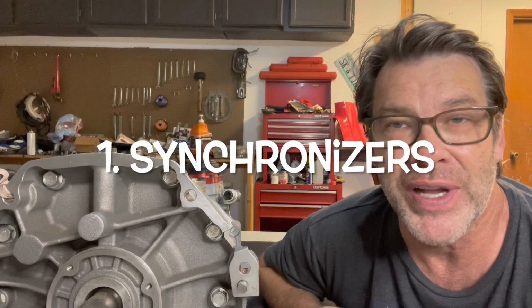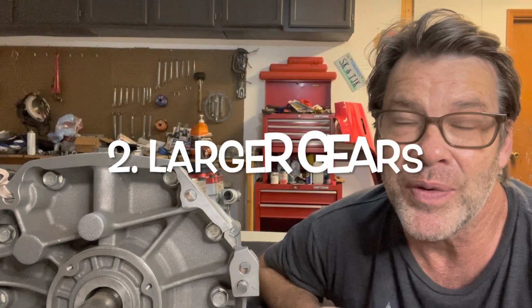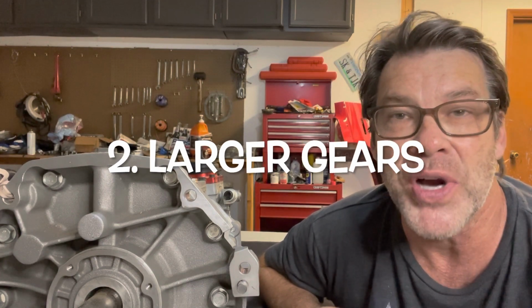All right, guys, let's talk about some of those improvements. Number one, you're gonna have much better synchronizers with this, the way they're designed. And in fact, the way that they're designed kind of brings me to number two. Because of the way they're designed, you can have much bigger gears, more surface area. And the more surface area and the larger the gear, the harder it is to break, okay? So that's the second thing, larger gears handle more torque.